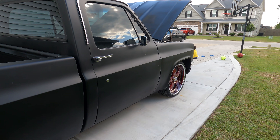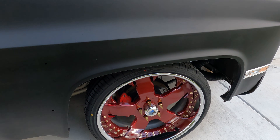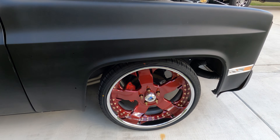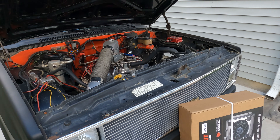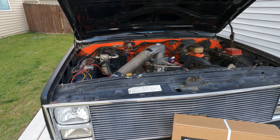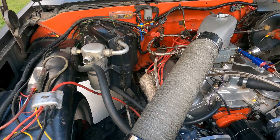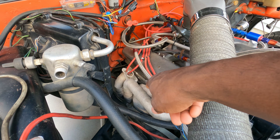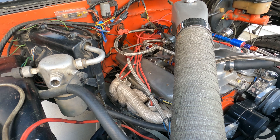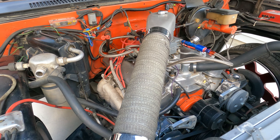We ordered another lip for this wheel right here — this was the one that had the bad lip — so we got that taken care of. I cleaned up on it yesterday, getting rid of all the pollen and stuff that was under the hood. I checked all my spark plug wires and found a wire on this side that was burnt, beneath cylinders two and four.